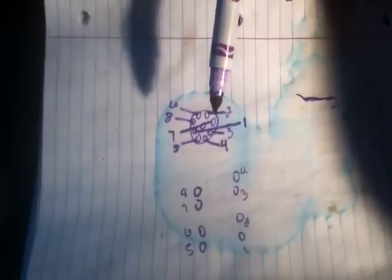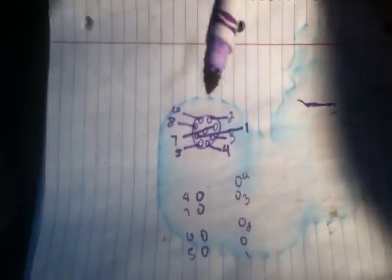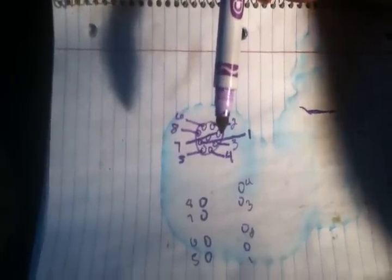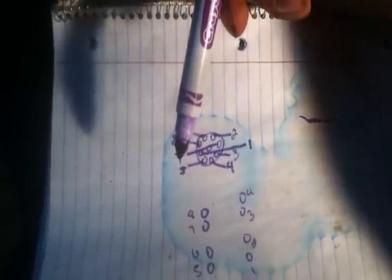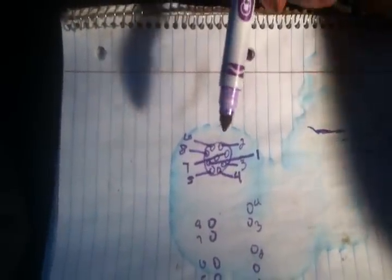Okay, and then what I like to do is I'll start in the back here, and I'll take this wire here and I'll follow it up, and I followed it around and it went down here too. So what I do is I draw a line with the marker coming off whichever way the direction of the wire is, just in case you forget which way these wires all go in here. And I just draw a line going that way, and I write 2 on there, and that means that goes to 2. Okay? And you see this next one here, the wire runs clean through and wiggles through all the way to the other side and goes over down here to 7. Alright? So I can tell all that stuff by a simple little diagram right here.